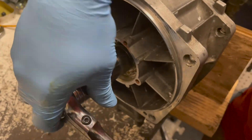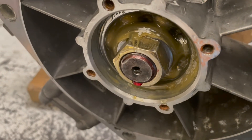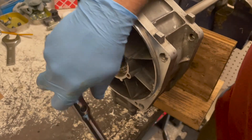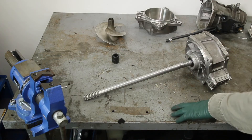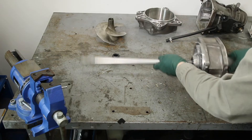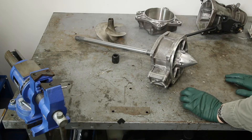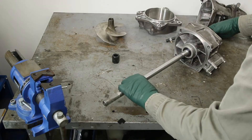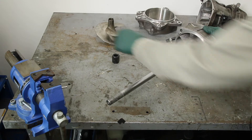When we're all done pulling the shaft in, we pull the nut out, clean the threads, apply red thread locker, and reinstall the nut and torque it. That is one nut you do not want to loosen up. Installing a new drive shaft in one of these is quite a pain, but we got it in and torqued. We filled the cap with the appropriate grease and we're using thread locker everywhere — just like the back. Now I can install the impeller, which is a lot easier to install than remove.